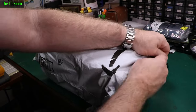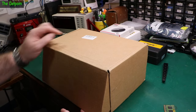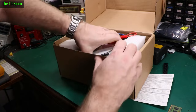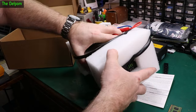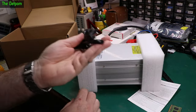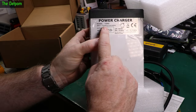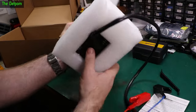Larger package now. It's a 29.2 volt 30 amp smart lithium multi-safety-protection charger. It's just a battery charger, but this is because I upgraded to lithium batteries in the motorhome, which was rather expensive. It has the wrong plug, but it's supposed to be multi-voltage — input is 110 to 240 volt AC, 50 to 60 hertz — so I can just change it to a New Zealand plug and it'll be fine.